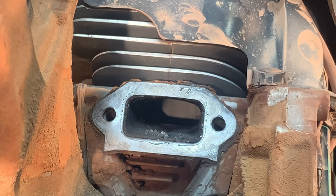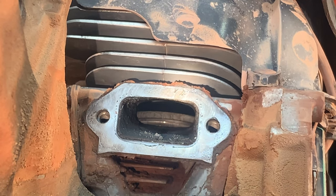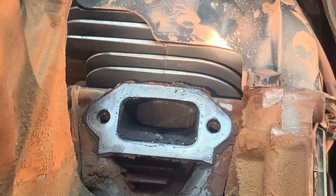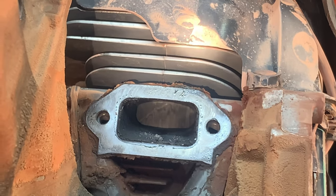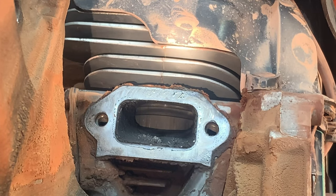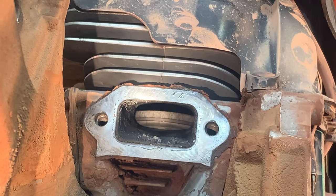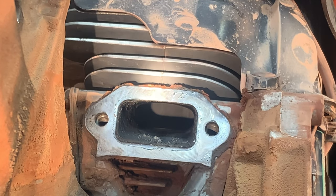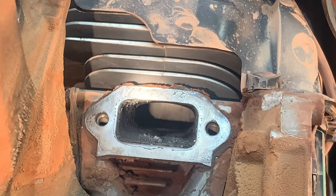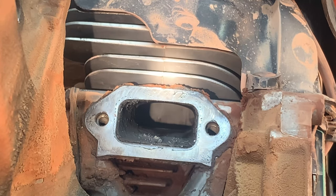All right, let's take a look at it together. It's as I figured — just based upon what they described, that piston is scored. Should be able to see that there. The rings don't look too bad. Now I think you can see the back of the cylinder — it is heavily scored as well.